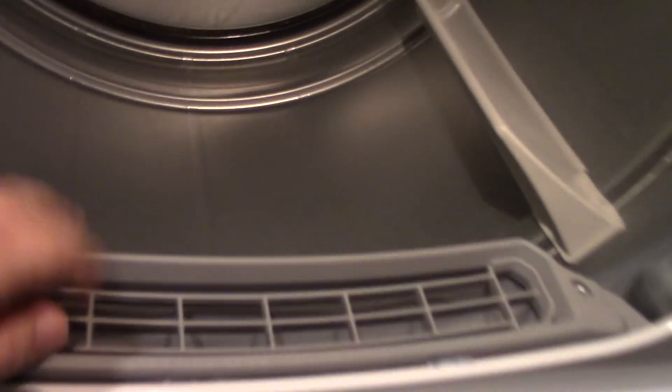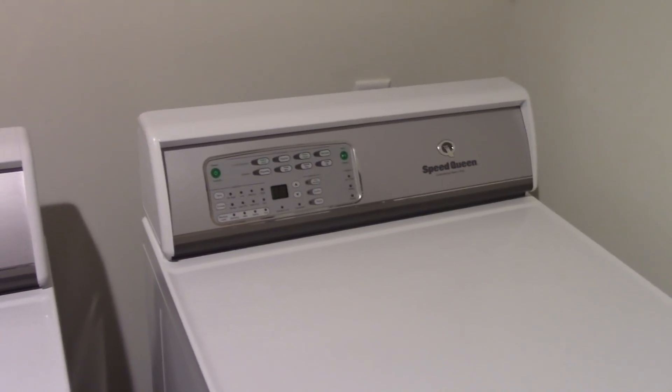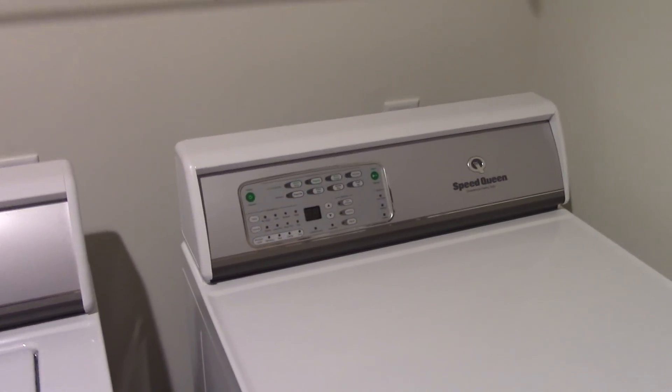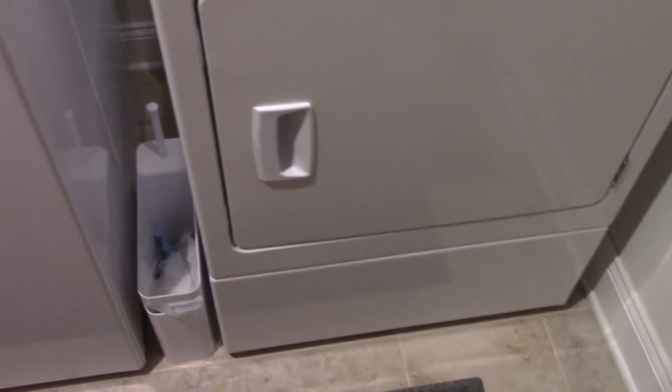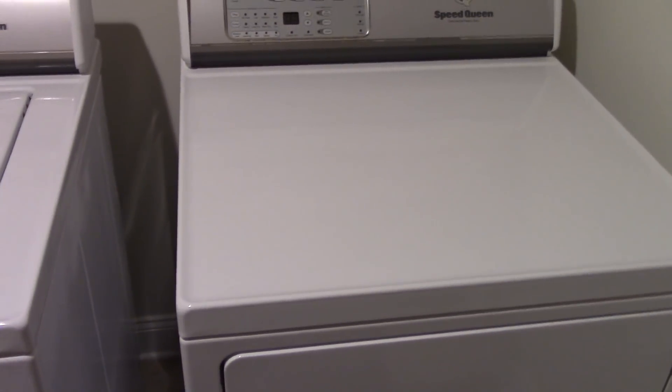One of the first things I tried was opening the door and looking at the lint filter — it was pretty full, so I emptied it out, put the grate back in, closed the door, and started the cycle again. Less than five minutes later the same thing happened again — towels on high heat. So I put the temperature down to medium with the towels and it ran with no problems. I also ran two full bedsheets on high heat, and since bedsheets are a lot lighter than towels, not a single problem.